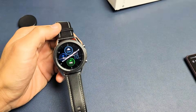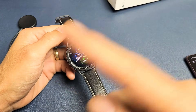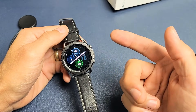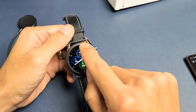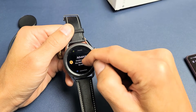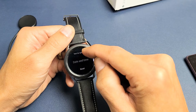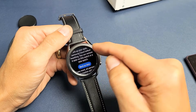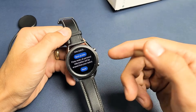If you're still down, the last method is to do a factory reset. It depends on whether your boot loop is consistently going or if it boots up and you have like one minute to get into your watch. If you do, as soon as it boots back up, go into your settings — slide down, go into settings, scroll down and look for General. Tap on General, slide down, go to Reset. You have an option to back up to Samsung Cloud if you have anything important. If not, just tap on Reset and do the factory reset.